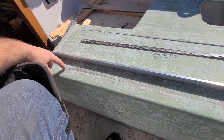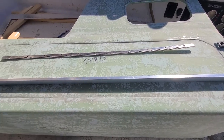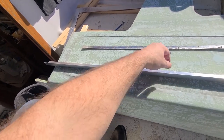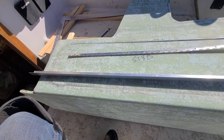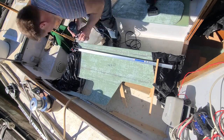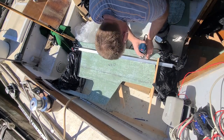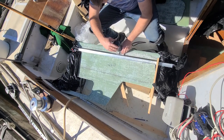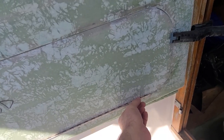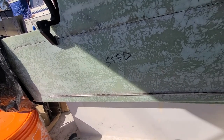at the same distance from here to the L bracket and from here to this side, and use a router for cutting the straight line. And I believe it'll be really straight, at least as straight as the L shape is. Well, that's my idea. The dry fit of the hinge looks straight, just need to sand around a little bit, and I guess this is it.